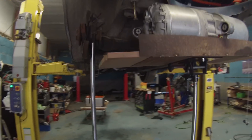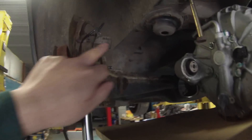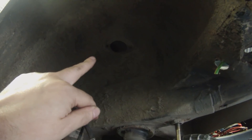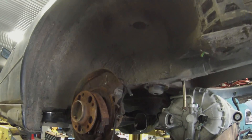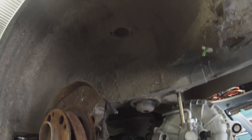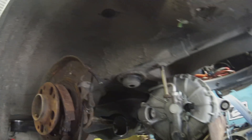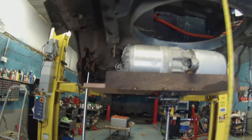The next challenge is to start looking at suspension. With this at our desired height, you can see this is our suspension mount onto the hub — that's the normal shock absorber mount. So we'll need a pretty short coil over to go in there. We'll also have to strengthen up that mounting because it'll now be taking the weight of the vehicle, so we may need to come back down to this chassis rail here.